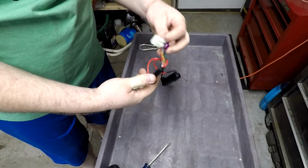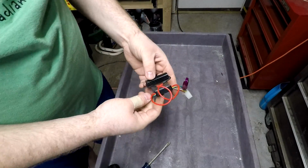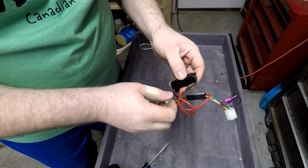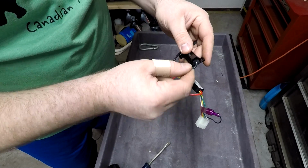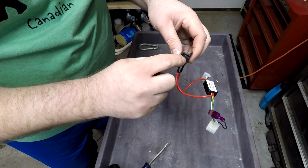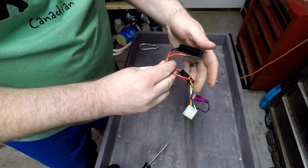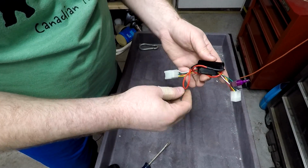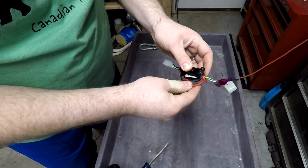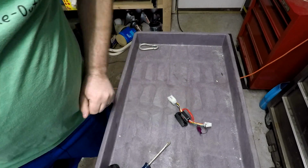Okay, hopefully you can see this, right? This is that resistor that we talked about. So the first thing I'm going to do, just to clean this up, is put a couple of little zip ties on here just to try to bring stuff together. Be careful. Where they're heat shrink in there, don't wiggle those back and forth very much or you will break them off. It's very, very fragile metal that's used for the ends of these resistors. It's not meant to be bent back and forth very much at all. So bend it once. I kind of bent these two into a loop, so go ahead, bend them in a loop, whatever you want to do, but don't bend these back and forth very much, just enough, okay? So I'll get a couple of little zip ties, we'll put them on there, and we'll show you what's next.